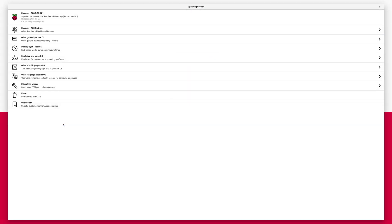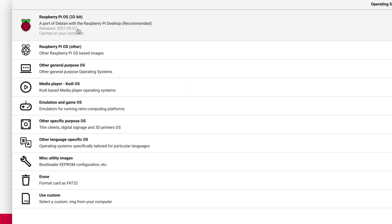All of the links I'm going to be using in this video you'll find in the blog post linked in the description. First thing we're going to need to do is get an SD card, plug it into your computer, and flash it with an operating system. If you go to the Raspberry Pi website you'll be able to download the Raspberry Pi installer. We can choose the OS — I'm going to be using Raspberry Pi OS 32-bit.